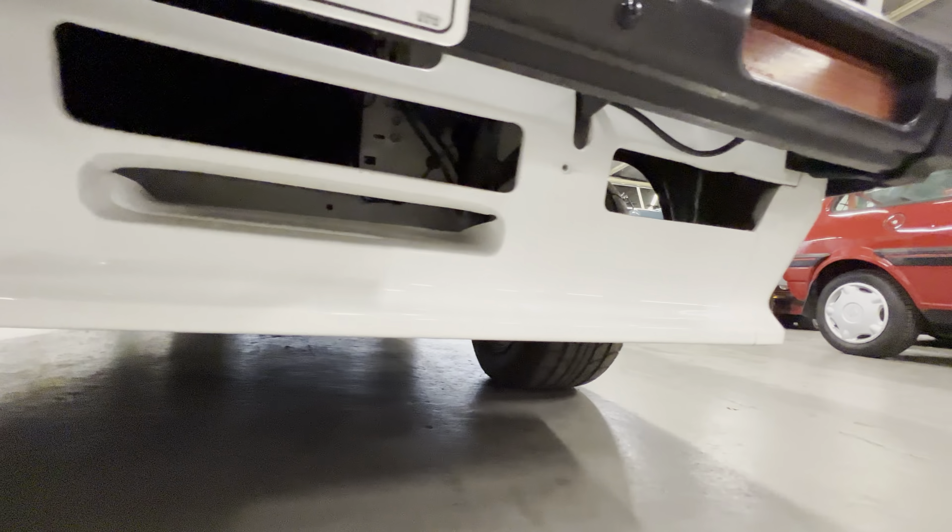The spoiler itself - these rubber spoilers do dry out and crack, but this one is lovely and tidy all the way along. The car has composite windows in the sides and the rear, all properly stamped - Lexan, which is the proper stuff. Lexan is super light, super strong, and importantly won't scratch and fade like cheaper perspex. Looking down the passenger side you can see just how straight it is and how fat those arches are. There has been a small scuff at some point on the arch that's been touched in - worth pointing out, but on a white car it'll be a very easy fix.